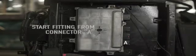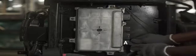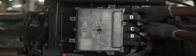To refit the connector, start fitting procedures from connector A. Pull the lock away from the BCU and ensure the connector is firmly locked. Repeat the same steps for remaining three B, C and D connectors.